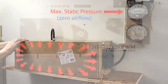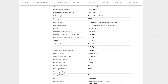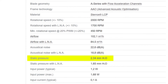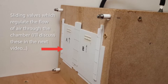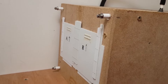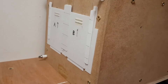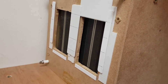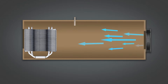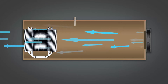This value is what you see quoted by manufacturers and vendors, and for most quiet 120mm PC fans it's extremely low — typically less than 30 Pascals, or approximately 3mm of water. Now, it's all well and good to talk about maximum static pressure, but in a real world setting, a PC fan will never have to deal with anywhere near that much pressure. So what I've done is I've put two heatsinks in the back of the chamber, which the fan will have to blow air through. So you'll have quite a good amount of airflow, but a little bit of static pressure.